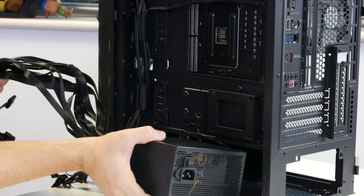I'm also going to install our storage because we can wire that up at the same time. You've got a couple of options: you can go for a more pricey M.2 drive, but if you're trying to maximize value a 2.5-inch SSD like the Barracuda Q1 is a great choice. One terabyte gives you the optimal capacity in my opinion, but a 480 gig drive will also do you nicely. The case comes with a handy sled that holds our 2.5-inch drive securely. We give it power with one of these SATA power connectors, as well as data by taking the included SATA data cable from our motherboard, plugging one end to the SSD and the other to the right-hand side of the motherboard.